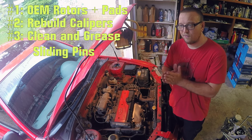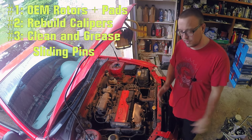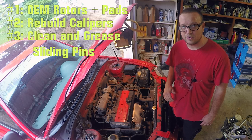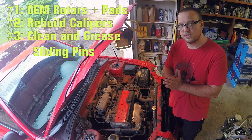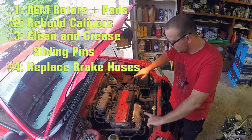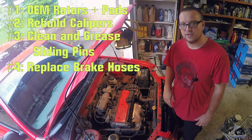What it is, is the brakes were not fully releasing — they were still kind of hovering and touching on the rotors, enough friction to cause overheating. I tested the theory by driving around without using the brakes at all, just downshifting and using the handbrake, and absolutely did not overheat the brakes. So it was just a matter of the first time you apply the brakes, they would not retract fully, which made me think the fluid was not retracting normally. So I changed the hoses — the little hoses right at the ends going from the wheel into the body. Changed both of those, still no difference.